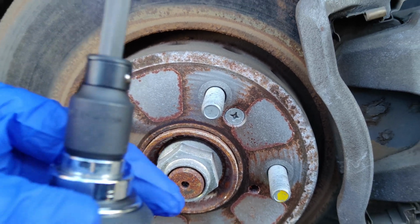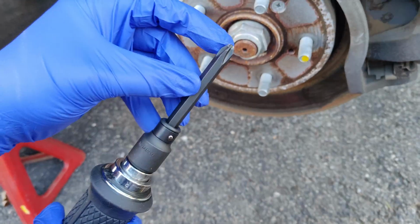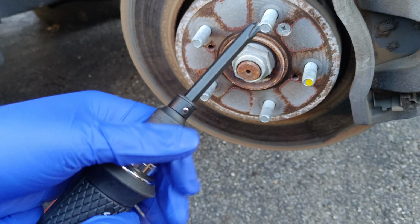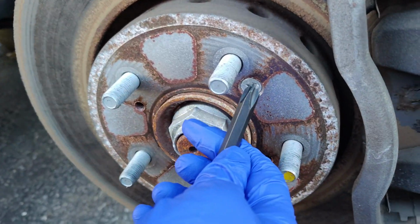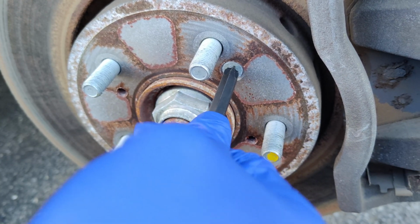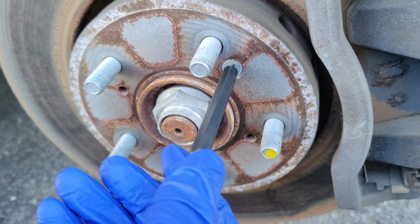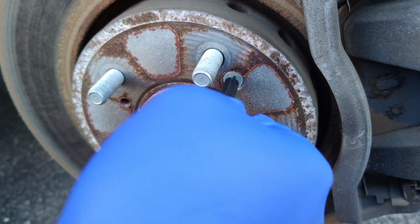It helps to have an impact tool, which is a hammer impact, like this. This is the JIS number 3. And this JIS number 3 is what needs to be used to get the Honda rotor screw off. If you look here, this is not a Phillips. If this is a Phillips, it won't fit. Look how that fits. It just stays in place. You don't even need to do anything. It's in place. It's tight.